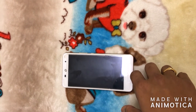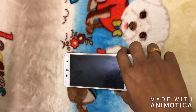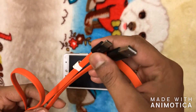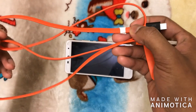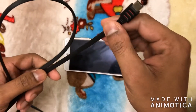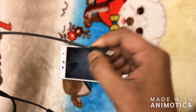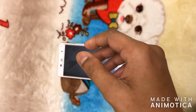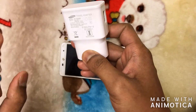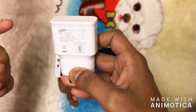What is the solution? Before going to the safe mode recovery, you need to verify there isn't any damage with your cable or adapter. This Type-C connector is the one from the manufacturer — make sure it is connected and there is no damage on the cable. If in doubt, try using a different cable. Also make sure you connect the phone to the wall socket using the adapter instead of a laptop or car charger, because they won't supply sufficient current.